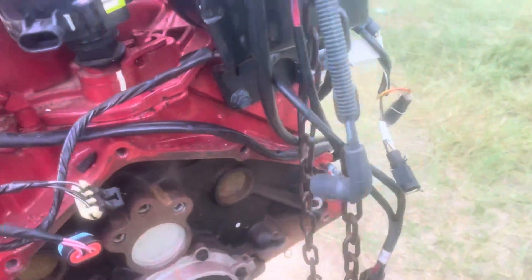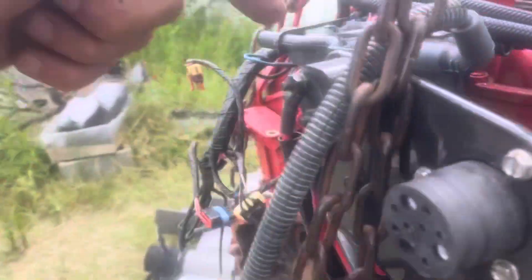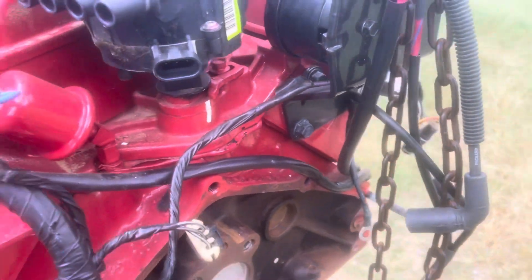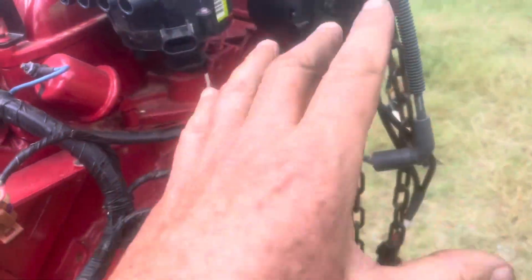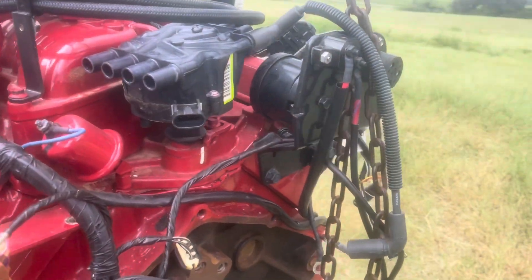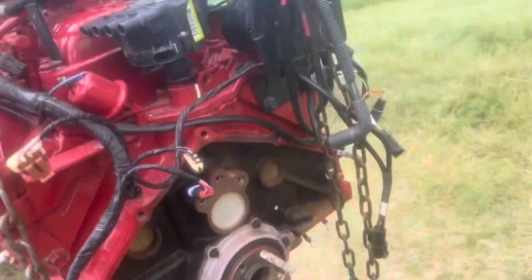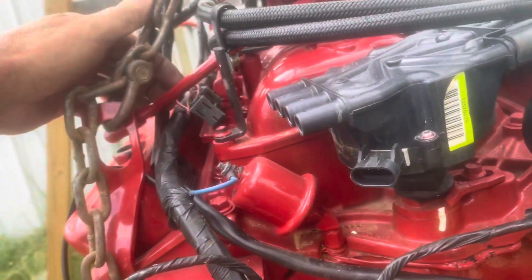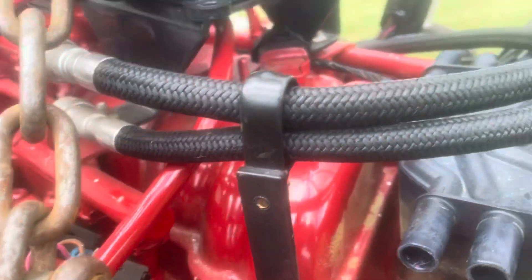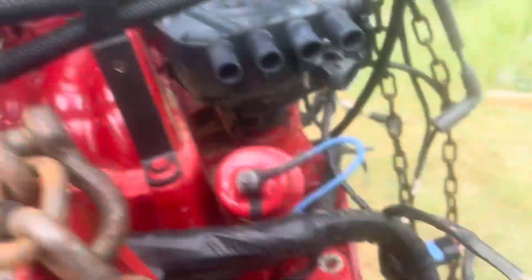The fuel system is off — I just disconnected the high pressure line and the return line off the fuel system and took it off as an assembly instead of trying to take the lines loose individually. We're almost at the point where I can take the harness off. They've got this nice electrical power distribution panel up here with fuses — your main power comes in here. I'm going to unplug that and then I think I can lift this harness out. This panel comes off here, the wires go down this way, so it all unwraps in this direction.